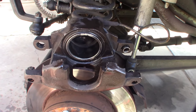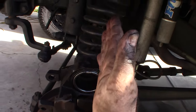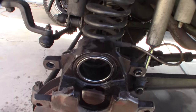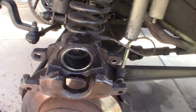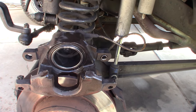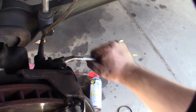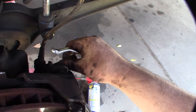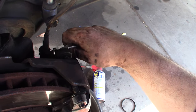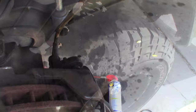Now that it's all clean and polished, I was able to push the piston back nice and easily — no binding, no locking up. It was probably some debris in there causing it to bind sideways. Now I put this back together, install the brake pads, and do a test. Before doing that, push the piston all the way back to minimize air in the system, then use the bleeder to get any remaining air out.